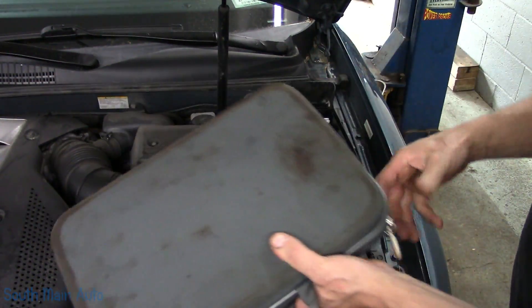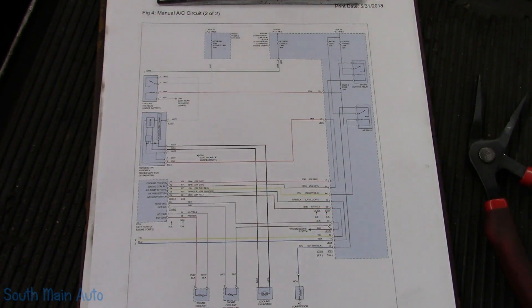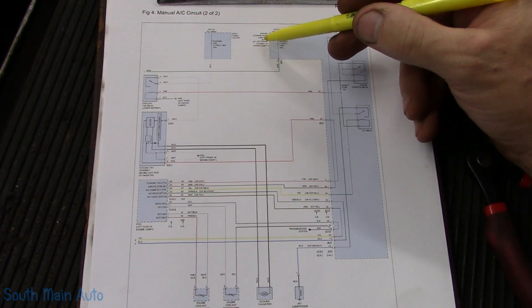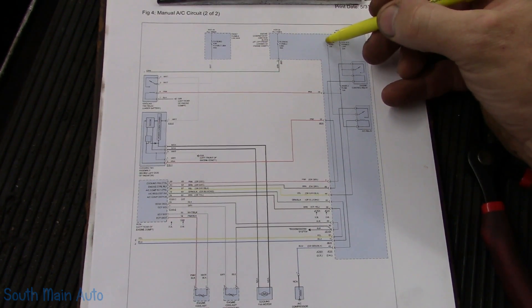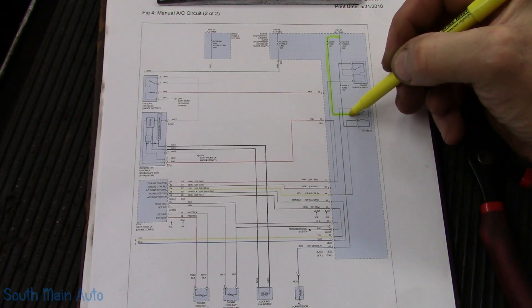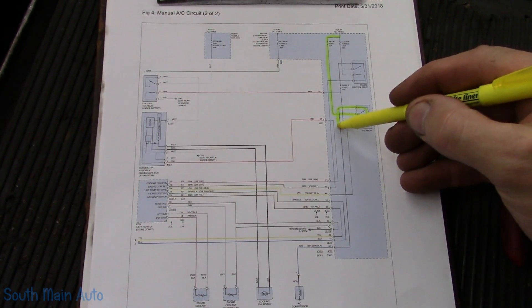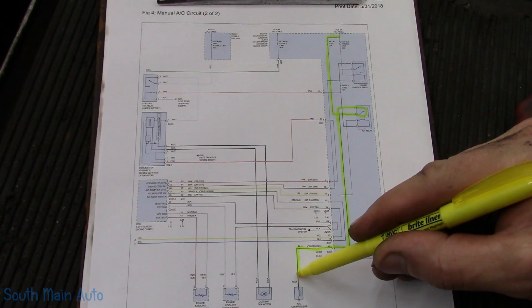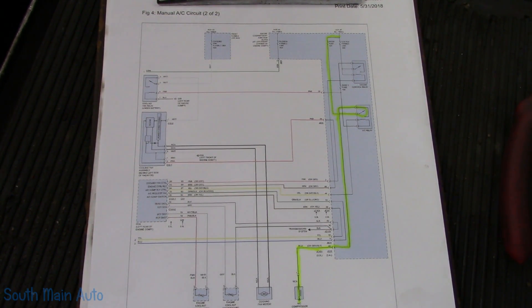I have my suspicions. Here's our aircon fuse — right there, 10 amp, in the front corner engine compartment underhood fuse box. There were actually two aircon fuses — one inside too. The circuit goes through the fuse box, through the relay when it closes, down through connectors, and straight into the field coil of the AC compressor. That is the circuit — it can't get much simpler than that. Single wire, nothing else feeding off from it, which makes sense for a 10-amp circuit.